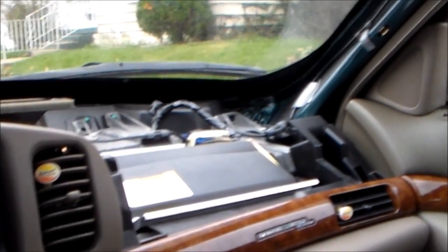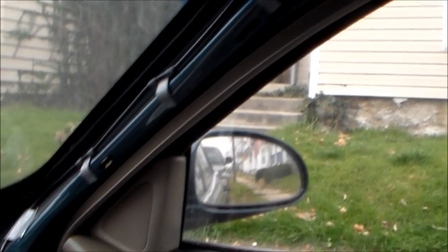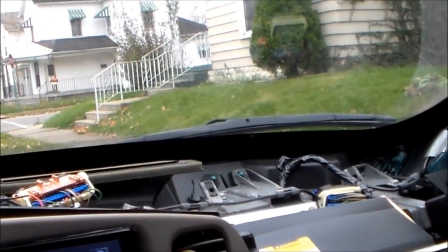accessory position. So now, what I didn't get to show you is these pillars, the covers, they have to come off in order to get that dash out. I'm getting ready to put the dash back in, the dash pad up here. Now, I showed you pretty much how to get that out. Up there, as you can see, there's a couple little holes right there, and there's a couple over here and one over there. Once you get this panel off, them holes down in there, they'll go in like this, and that's what holds this dash in.